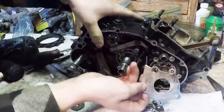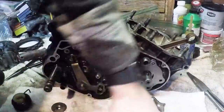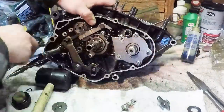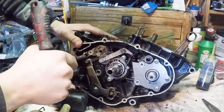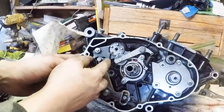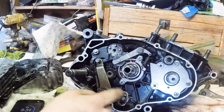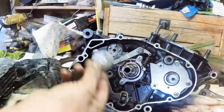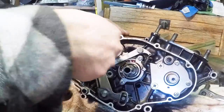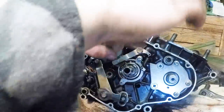Next, this pretty much certainly goes right there. I think all that really does is help shift the gears - it's kind of a secondary propulsion thing for the gear shifter. I've got that on, and next is this little plate. There's a little pin that goes in the selector drum, and then this plate goes over top. It's spinning the drum while I'm trying to tighten that - I guess I can just get it all the way over and then tighten it up.